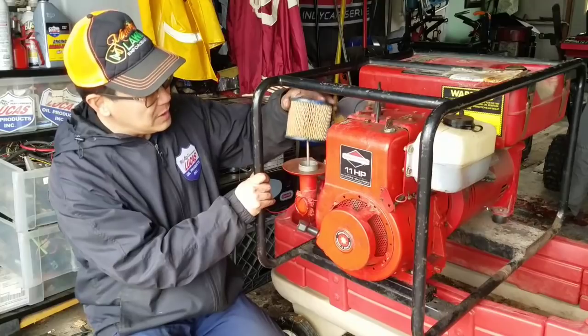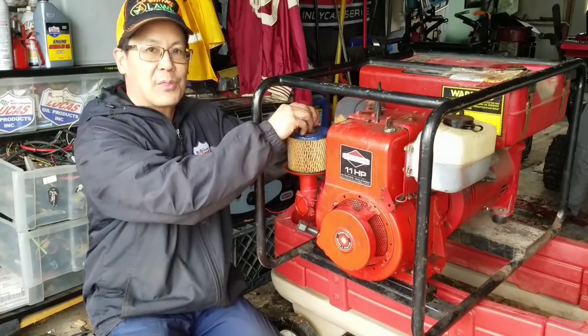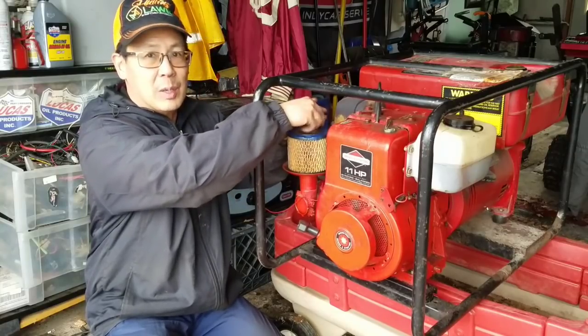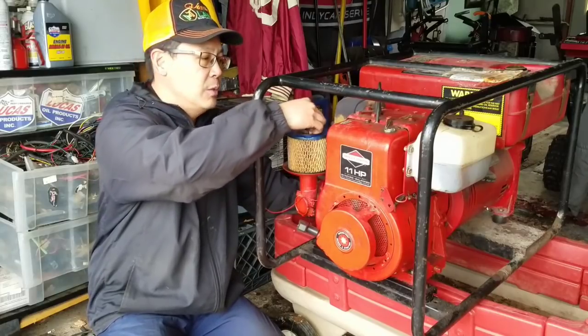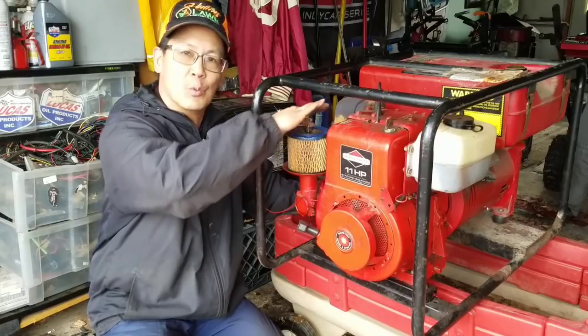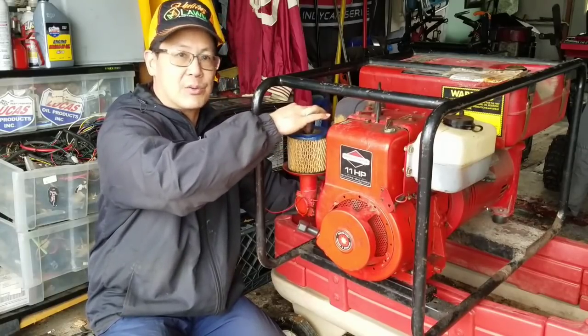How about it? What we did was we changed the magneto, right? Went through like 30 magnetos. That's what really took a long time, was finding the magneto in a box of like 30 different sizes and manufacturers. We finally did find four of them. The first one I tried, which was the one that looked the nicest, worked just great. Started, fired right up.